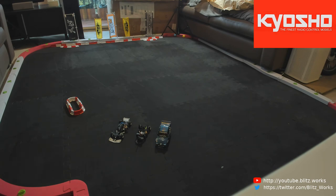I managed to put the Atomic DRZ V1 servo horn onto it and found there was a good deal of flex in the plastic steering horn due to the steering geometry. Going to a metal servo horn made it a lot better. However, the left and right turn are not symmetrical, and when turned to the right at max angle the servo can actually bend the servo horn, so I'm very tempted to go back.